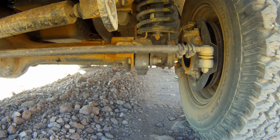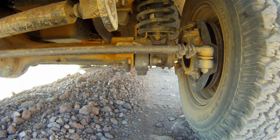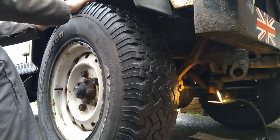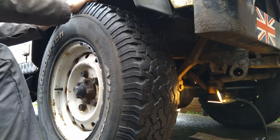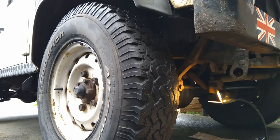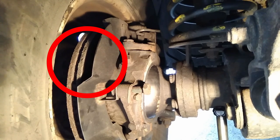To do this properly you need either an assistant or, in this case, I got a camera underneath the vehicle. You basically jack up each wheel and feel for the wheel bearing play, and this is where the camera really helps — because you can see wobbling the wheel here. The tyre is moving, so when you're on the outside pushing the tyre it feels like there's a bit of play, but really what you want to be looking at is the bit circled on the screen, which is the movement of the brake disc relative to the rest of the axle.